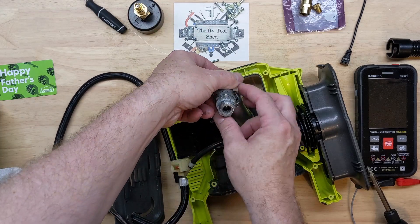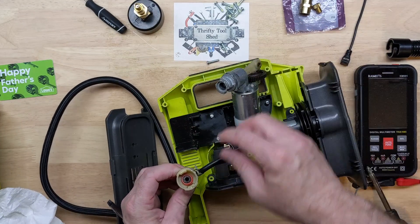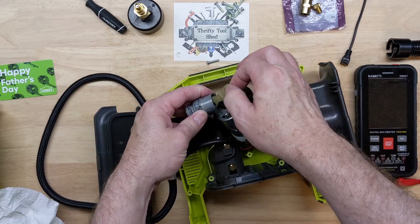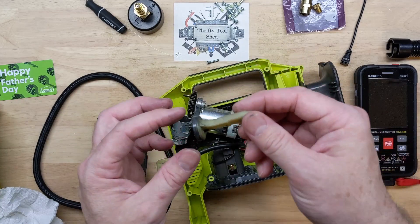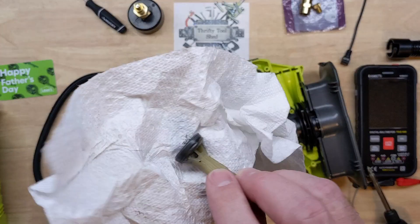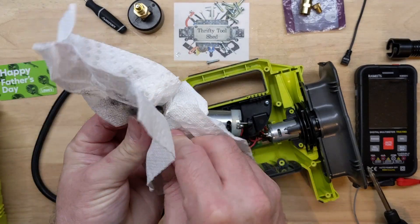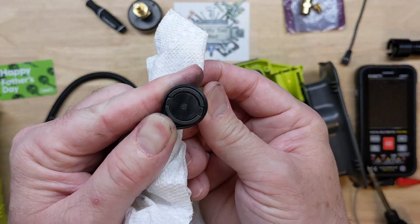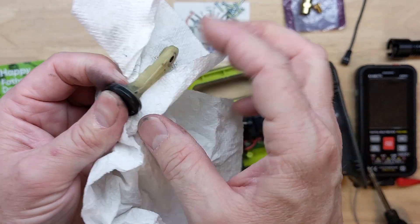Just pulling the bottom of the little check valve assembly off, I can see the check ball in there. Spring and seal looks good. Getting the piston out — yeah, it's dirty and it feels kind of hardened to me. Some of these seals are high-temp rated, but I still wouldn't think it'd be quite that hard. I think the heat has gotten to it. So this is not just a ring or seal — it also has the reed built in.